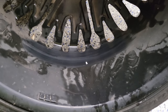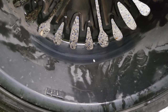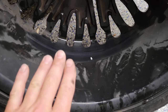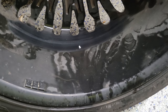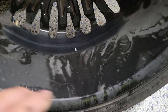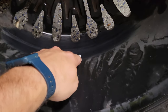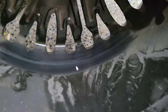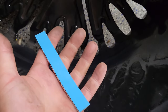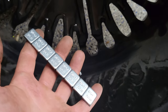Let me start by saying this is not typically the way I would want to balance these wheels. Because of the sheer amount of weight that's already on them, I don't know that I'll be able to get these balanced with this balancer — I think there might be something more behind this. Really the right way would be stripping all the weights off and starting from fresh, putting those weights dead center in the middle of this wheel. All you need to do is take some basic rubbing alcohol and a rag and wipe this thing clean, let it dry, make sure there is no moisture there, then peel off the back of our sticky weights and apply them right here. These sticky weights are from Harbor Freight — I don't necessarily recommend these because they don't stick very well. This video is getting posted either way, whether it works or it doesn't.